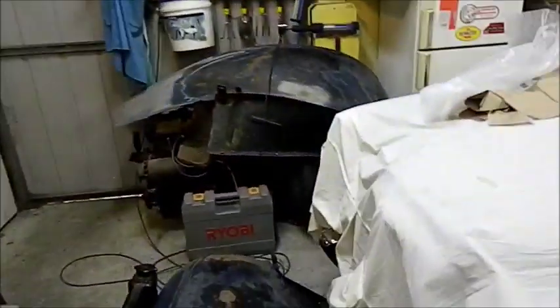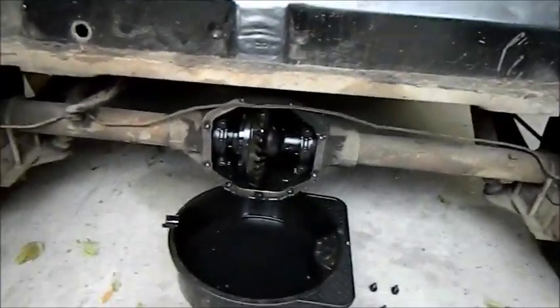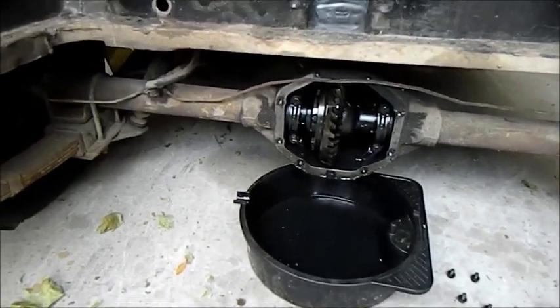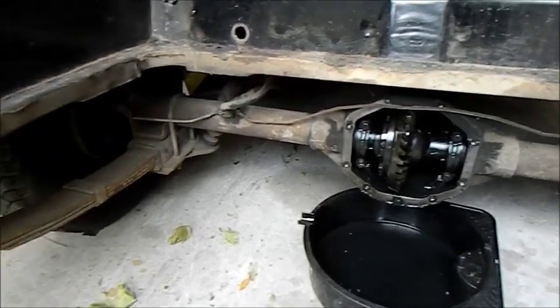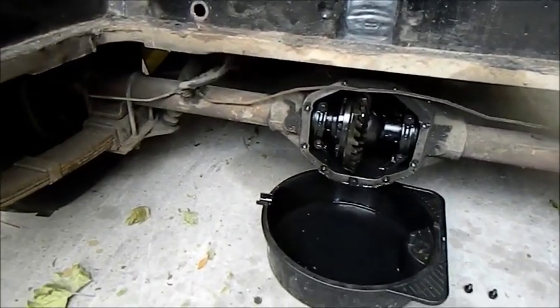Well, this is how you're going to roll if you're going to do two cars up at the same time. I've got crap absolutely everywhere. The other thing I'm not too wrapped about is the rear axle ratio in this car. There was a little bit of noise coming from one of the bearings, but the insides look absolutely brilliant. It's very difficult to find these axles. There have been a whole lot of them available because people have pulled them out and put 9-inch rear ends in. But a lot of the 6s had 3.25 and 3.5 gearing, and that's not what I want for a V8.